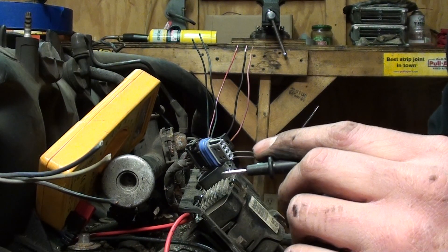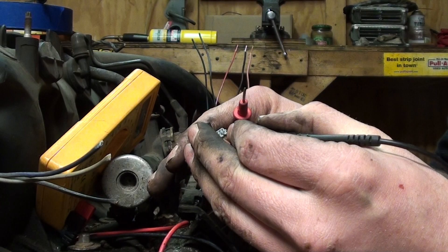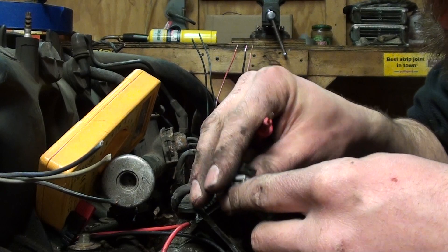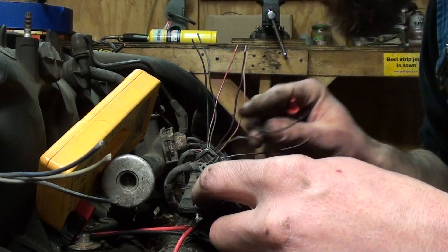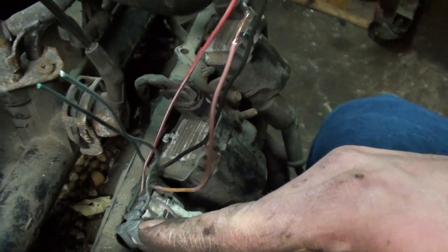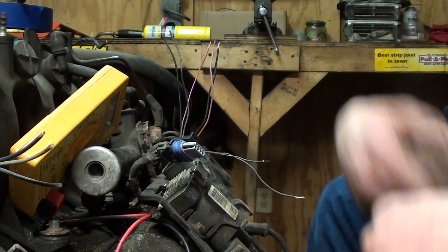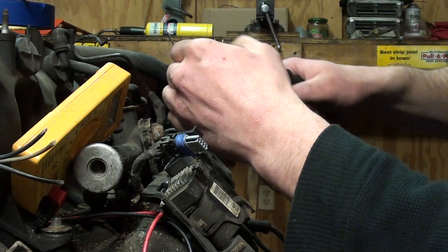The brown coil wires — I'm going to find out right now by doing a continuity check. The brown always goes to the cylinder head, directly to the cylinder head, nothing else. Let's find out where that brown goes. The brown wire is this one — the top left corner in the harness. That's how you test continuity. That brown goes to the cylinder head.